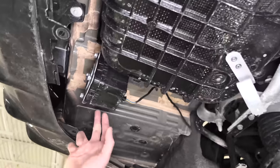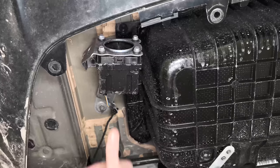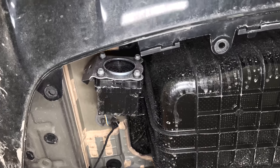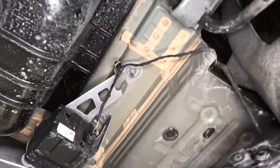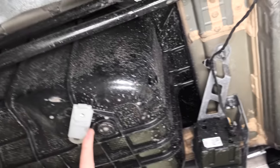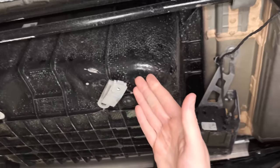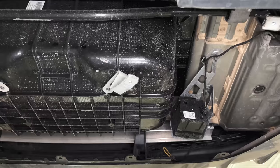Looking at the pedestrian warning system bracket — this is essentially a flat piece of steel with a substantial amount of offal. The overall utilization of it is poor. I understand the constraints they may have to pick up existing mounting points, but it could be better executed. Even if you had to have these brackets in steel and didn't want to use stamping, why are they not done in tooled draw — an interface where you could have a snap provision, where if you need this for compliance you could slide them into place and get rid of these fasteners?